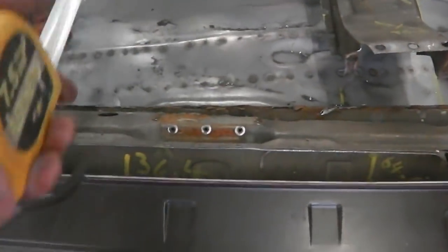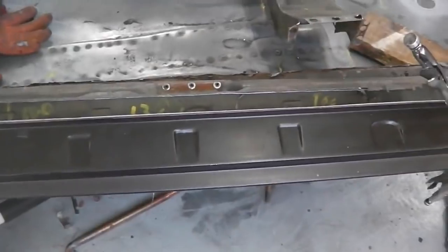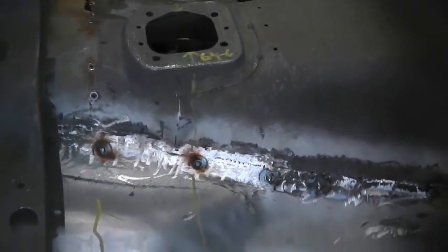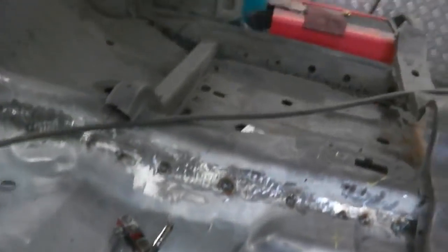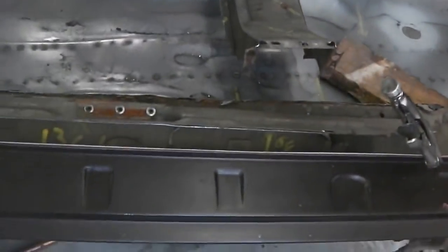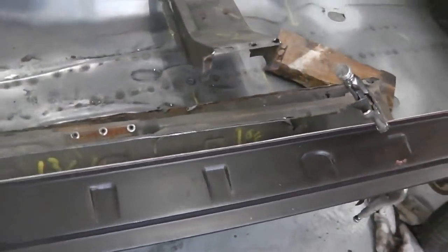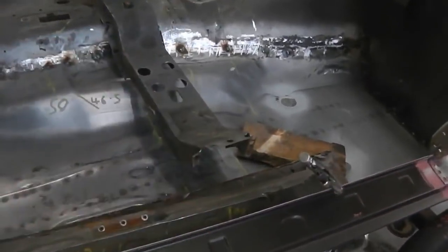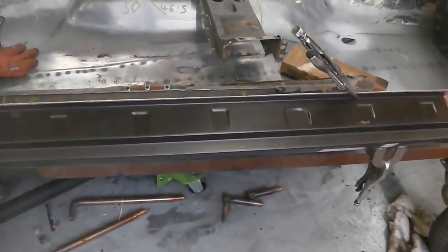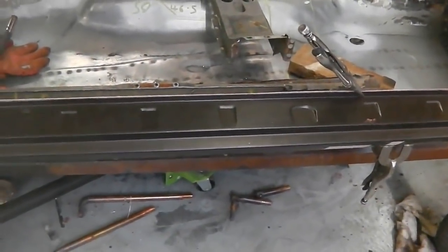So, tape measure out, off, and then we go for a couple of checks. Transmission tunnel aperture, it's just to get a reading up this end, a bit of a guide. And then we've got 88 going from the 88 mark up on the roof there. That gives us the aperture opening. I'll check those. I'm sure it's going to be right. Can't do it with one hand, but we're ready to check. Not a lot I can do if it ain't, but it's nice just to know it all went together.